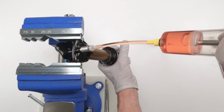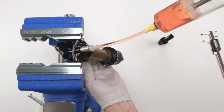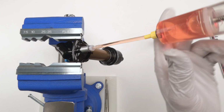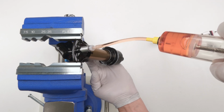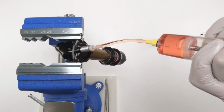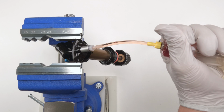I really think we're good. I'm going to do it one more time. So let me bring them all the way up. Let me suck in the IFP. No air bubbles there. Let's push out the IFP. IFP's all the way out. Now let's push out this side. That will always come out after the IFP. Pressurize the system really good.